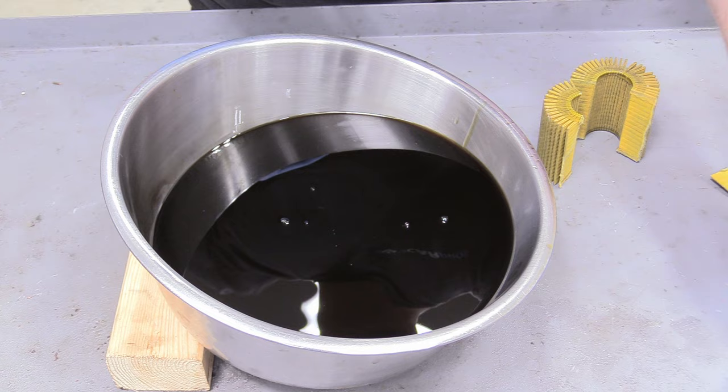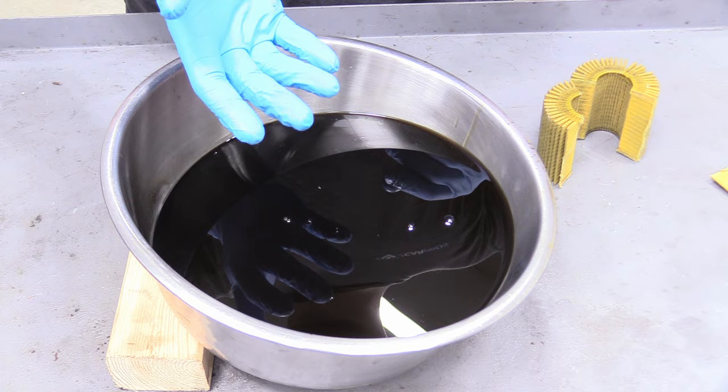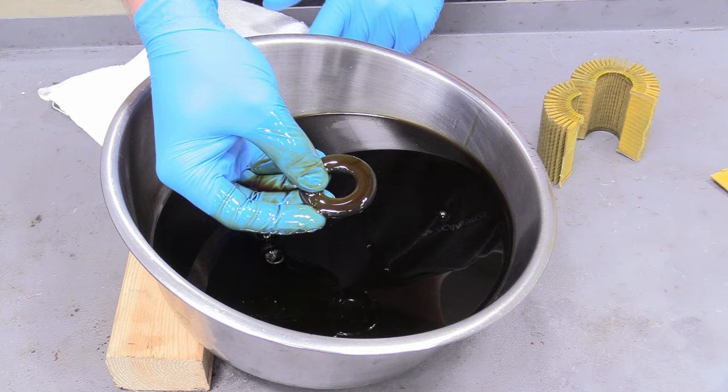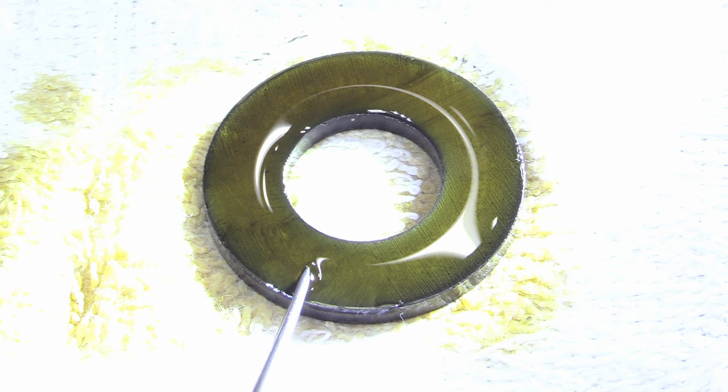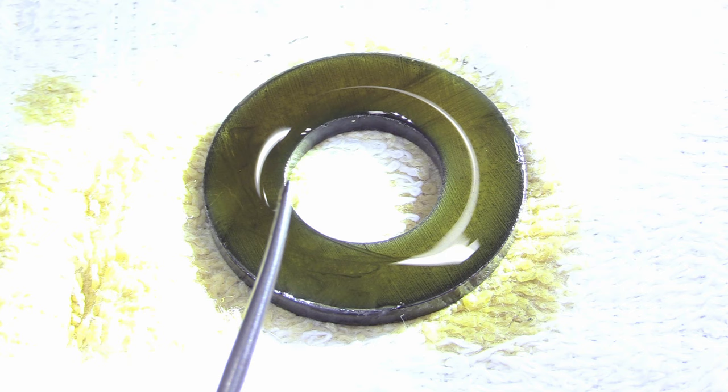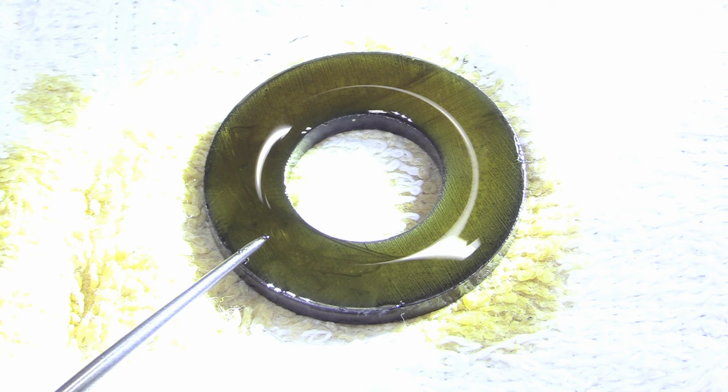Next I'm going to fetch my magnet. I'll make sure I have my gloved hand because oil can be icky, and I'm just going to fish in there — it's not too deep — and pull that out so we can get a good look at it and see if it has any glinties on there as well. Taking a very close look at that magnet: there is no metal on here at all. This is perfectly clean. As far as I can tell so far, there is nothing to worry about in our oil — but this only proves there's no magnetic material.